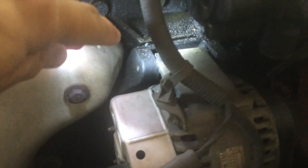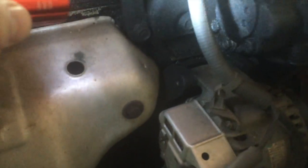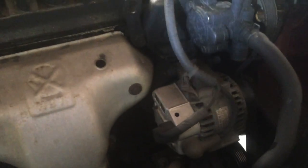This looks a bit wet back in here, which could mean there's a bad seal and it's coming out the backside. We can also just check and see if everything's tightened down. Go ahead and turn it on and turn the wheel — we'll see if anything's leaking out. Just turn it far to the right and then far to the left.